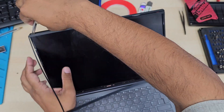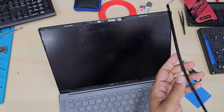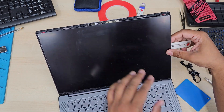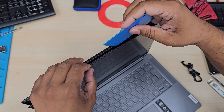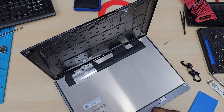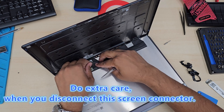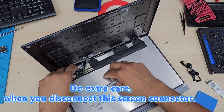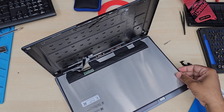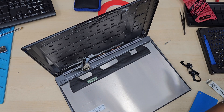The question is how to put it back and what adhesive to use. Honestly, I just used double-sided tape on the back of the screen, and left the front bezel itself without extra tape, because the bezel already has some adhesive that should cover it. Just make sure to put it on a clean surface, otherwise the adhesive will weaken and it won't hold. Here is the main screen.